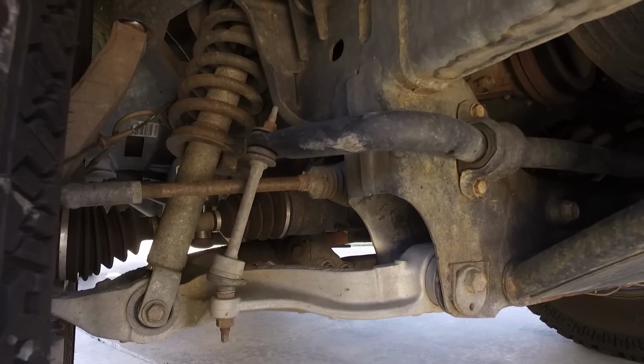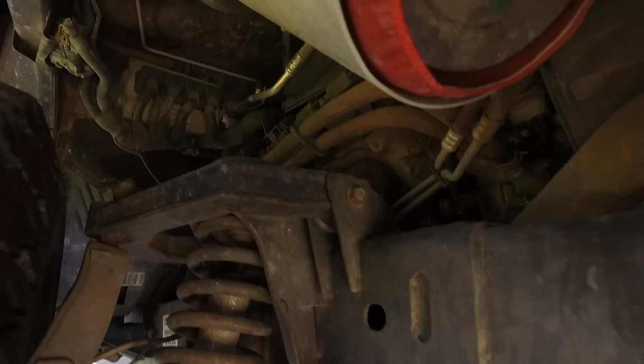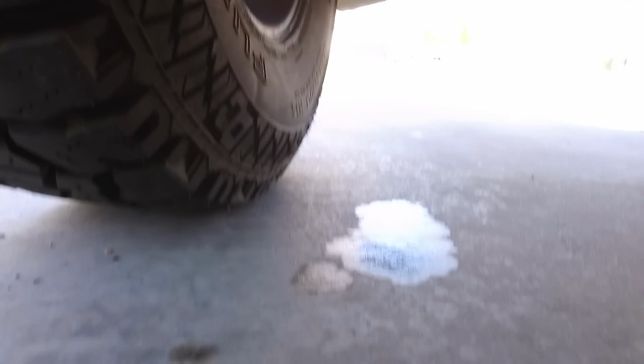The suspension looks to be mostly stock. There are some custom upper control arms in the front, and there are added bump stops. The ones in the rear have been hit so hard they're broken, and the cool Edelbrock reservoir shocks aren't any good anymore either. The first indicator is that there is more oil on the outside of the shocks and on the ground than on the inside, but we'll deal with that later.